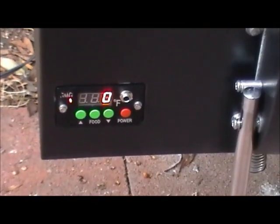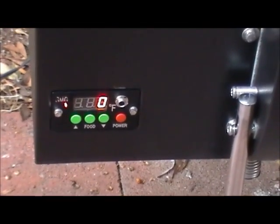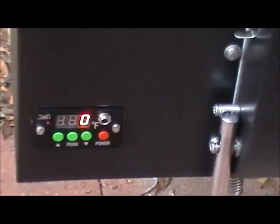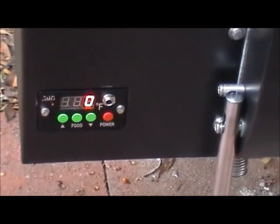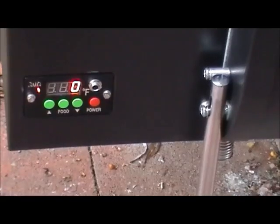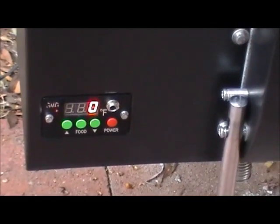After you turn the grill on, your controller is going to cycle the auger and the fan, and charge the auger and dump pellets into the firebox. And you want to let this thing go through its whole cycle before you try and adjust the temperature. And you'll know when it's ready. You can see the lights flashing on it now. Start smelling the pellets burn.